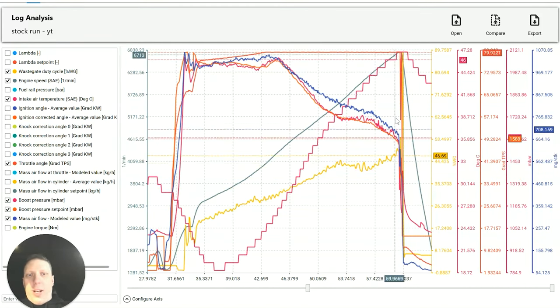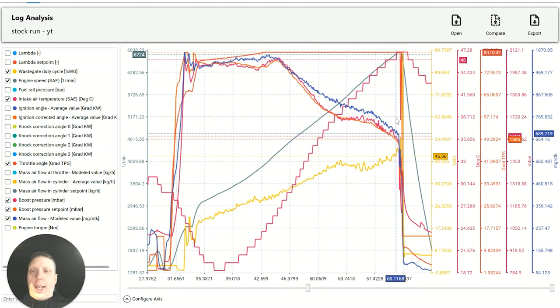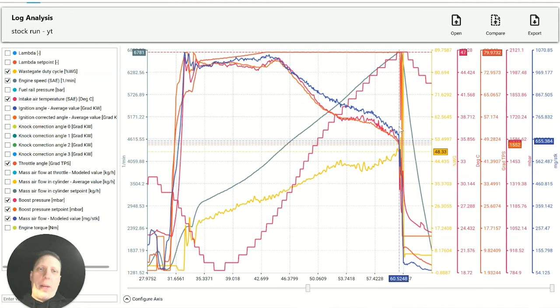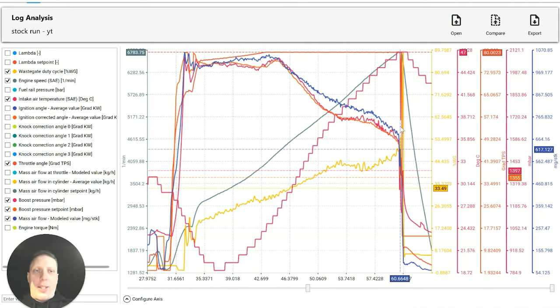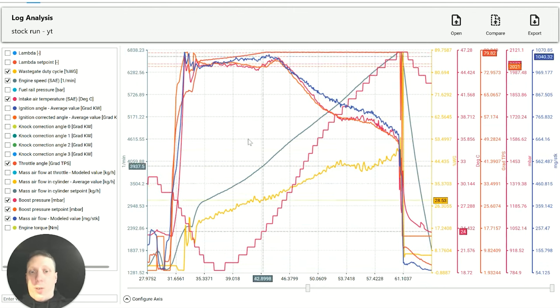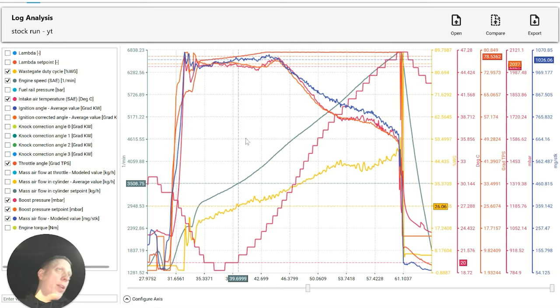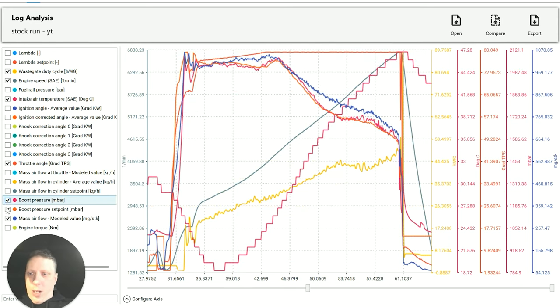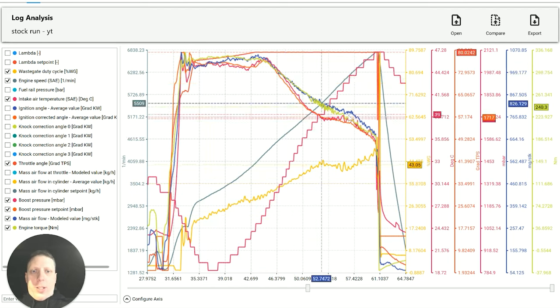So this is where we build the stages. We're looking at what the weakest link is at different parts of the tuning to see what you have to buy to do the next stage. So obviously stage two, and even at stage one, I'd probably recommend an intercooler because it's already running quite warm. The room is only 14 degrees and I'm hitting 47. So that's not ideal.